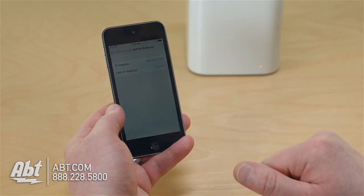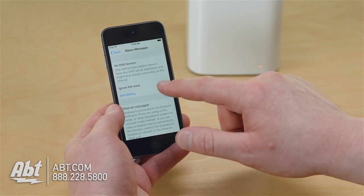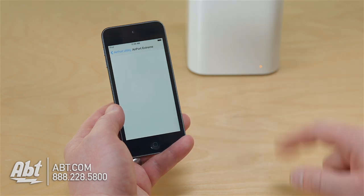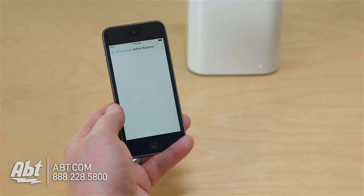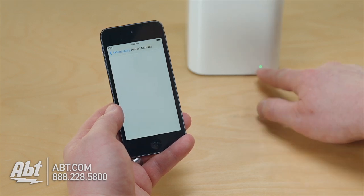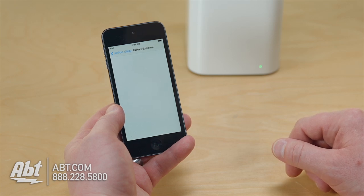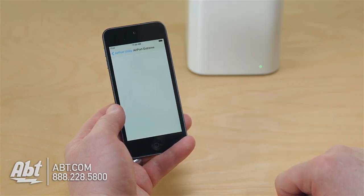I got my Wi-Fi logo back. I have one more message: no DNS — again, because I have no modem. I'm going to say let's ignore that. It's going solid amber, I lost my Wi-Fi, it's rebooting. When it comes back I want to see a solid green light, and that's what you should have with your Airport Extreme Base Stations or Time Capsule in your home. There's my green. It's always helpful to power down and turn back on an Airport Extreme Base Station — it really helps refresh its ability to log on to a clear channel. A lot of us will unplug and re-plug our Airport Extremes, or use Airport Utility software to just reboot it. I've got a green — I'm good to go.